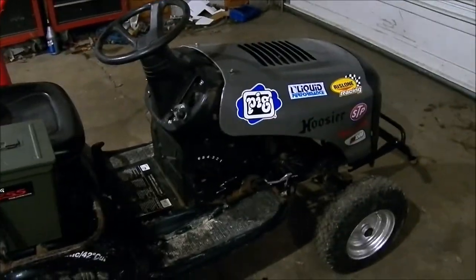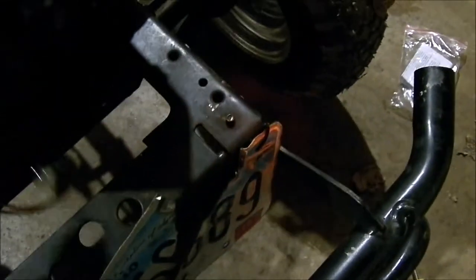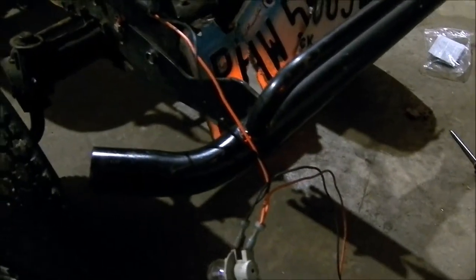I'm gonna take the hood off and show you how it's done. I've installed the lights in the front of the hood and the wires are coming back through here. They have a recommended way using all the fancy wires they gave you, but I'm just gonna use the original setup I have here because I don't feel like digging through all the wire loom. All I'm gonna do is take these wires and cut a couple of them and reattach them directly, so everything will hook right up and it should be pretty easy.